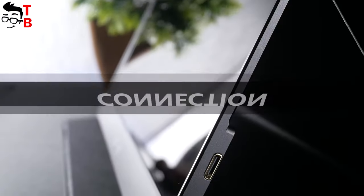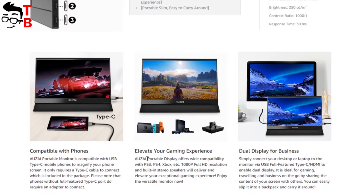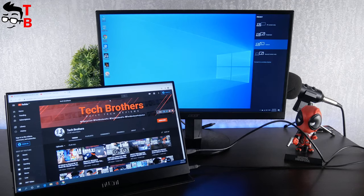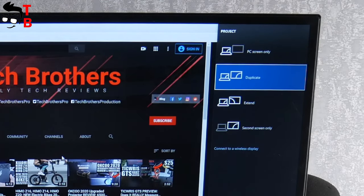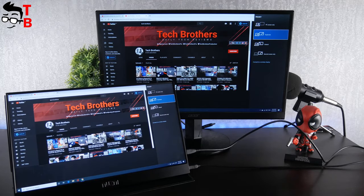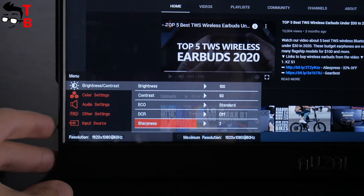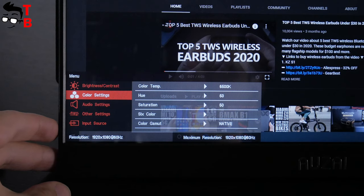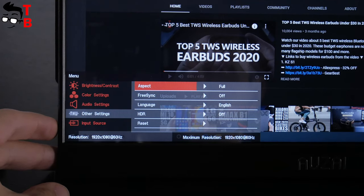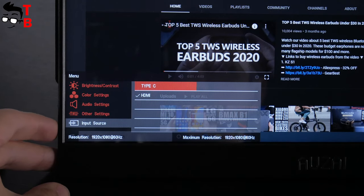Finally, we can turn on the monitor. You can connect the monitor to a laptop, PC, game console, TV stick, TV box, or even a smartphone. You can use the USB Type-C port or mini HDMI port for connection. I will use it as a second monitor for my PC. Windows offers four usage modes for the second monitor: PC screen only, duplicate, extend, and second screen only. If you connect the monitor to a game console, TV box, or smartphone, it will duplicate the main screen. The portable monitor also has a menu — just press the volume rocker to enter it. Use the power button to navigate. Here you can change brightness, contrast, eco, DCR, and sharpness. There are also color settings, audio settings, and other settings such as aspect ratio, language, and HDR. You can also select the input source: USB-C or HDMI.